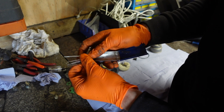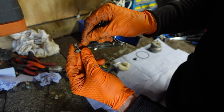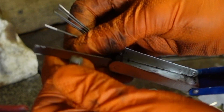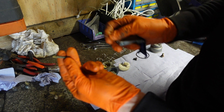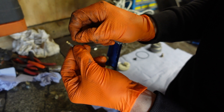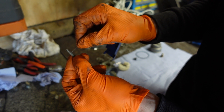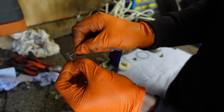I have these welding tips here which are very good for working on small engines. You can use these to clean the jets out. You can see that hole there is blocked up — it will go through from the other side. Step up to a bigger tip once you're through, and now see that is clean. Do the same on your jet, just make sure every single hole is nice and clean. Compressed air doesn't get it all, so you may just have to come back through with these tip cleaners. For what these tip cleaners cost, I'd recommend getting them in your toolbox.